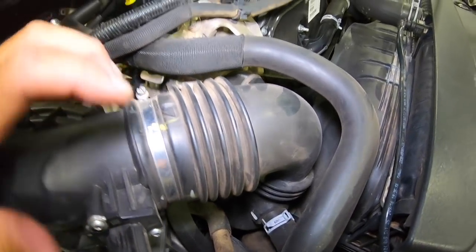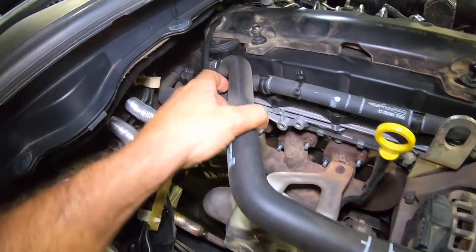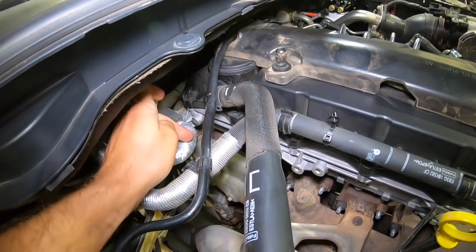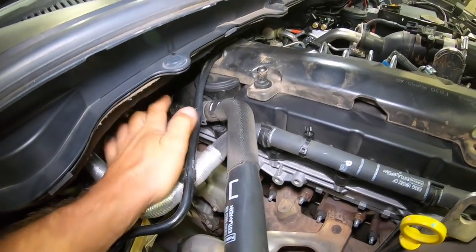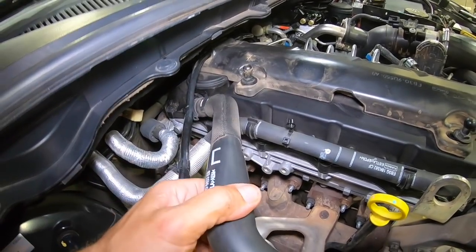So all you're getting is just oily mist and stuff all through your intake pipes and intercooler. Not good for anything. So what we're going to do, we're going to take this one off up here, spin that 90 around. One of the pipes will join from there and go over to there. The other one will come round and there'll be a joiner where we just join this one back up.